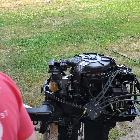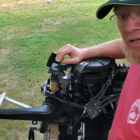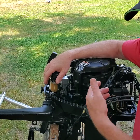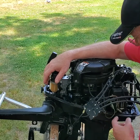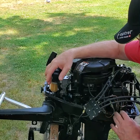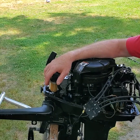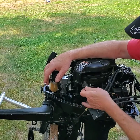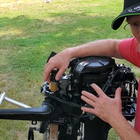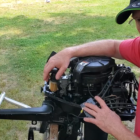Still no spark. So now the bucket of parts comes into play — he's changed the trigger, he's changed the stator, he's changed the switch box. We've got to find out about this ignition module. I think he said he has the original in the box. I also noticed there's a chafe guard that needs to go back on the trigger winding so they don't hit the flywheel — that's really important. I'll get set up to do a resistance test on those components in the next video, then go through the diagnosis process and show you how to fix it.